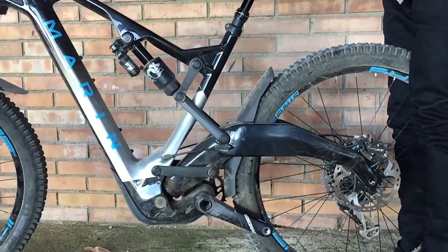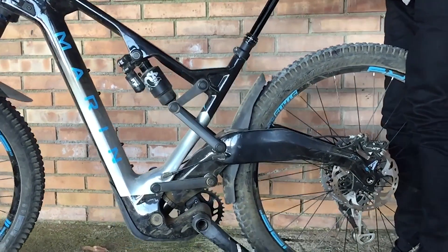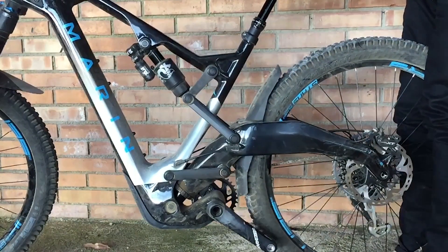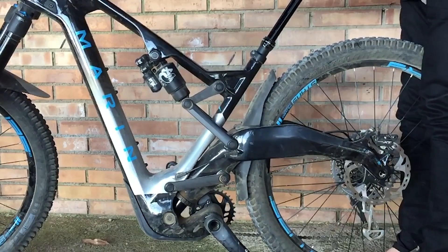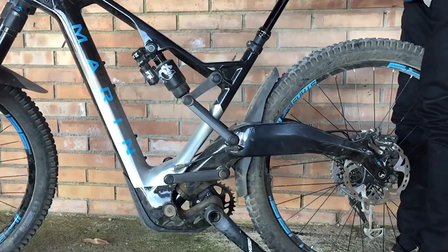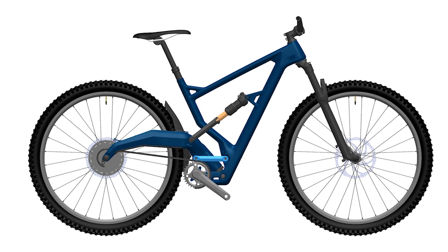One of the best things about this bike is the Nailed React 2 suspension system. This is the second bike that we've come out with the Nailed system. The Nailed team is a group of industry veterans who look at suspension through a different lens. Nailed has controlled the transfer of the rider's mass under pedaling load and acceleration, which would otherwise squat or compress the rear suspension — what we know today as pedal bob. They have found a way to isolate that rider's transfer of mass so that we can have a 60% reduction in damping in the rear shock.